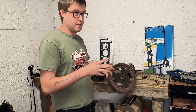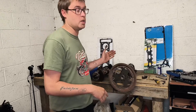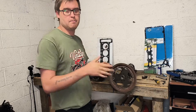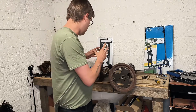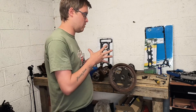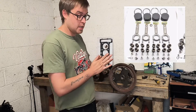It is possible. The thing with the M111 is it's a rod-guided piston — some engines have a piston-guided rod and the pistons are designed as such. These pistons are not designed to guide the rod, so I have to make sure the crank will guide the rod correctly without any funny movement. None of this is set in stone — if it becomes more financially viable to just do it the right way rather than mix and match parts, that's the route I'll go.